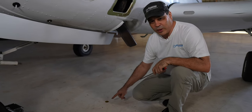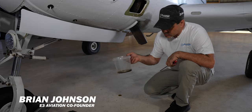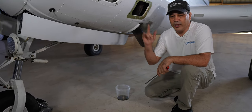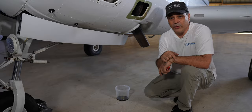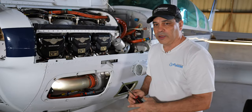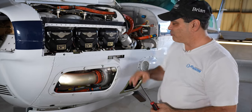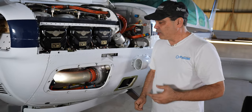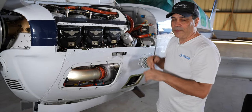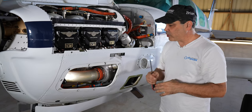Hey everybody, welcome back. Over the past three weeks this is kind of what has built up underneath here, and what we think it is are the check valves around the turbo. Today we're going to take you through how we check this and figure out which one it is, because one's really cheap and one's really expensive — fifteen hundred dollars for the one in the back. Typically what happens is when we shut down, the oil settles on those check valves, and if the rings are bad or loose, that's where they drip.